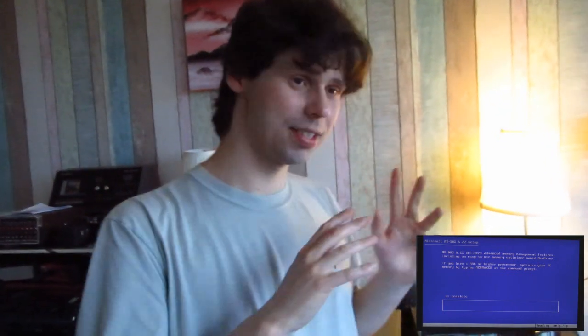This thing has a 486 SX CPU, which is a cheaper version of the 486 in that it has no floating point unit, so floating point is in software. It has a whopping 4 megabytes of memory, and currently a 127 megabyte hard drive. The screen is an LCD screen in good old grayscale. It also has a VGA graphics chip, which can output VGA to the TV. It can do a maximum resolution of 640 by 480 pixels at a maximum of 65k colors, which is quite impressive, except that the graphics chip only supports 16 colors on the screen at one time.